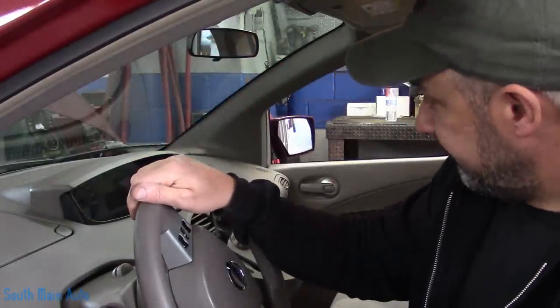So I guess that's it. We're not exempt from making mistakes — myself included, I've done it plenty of times. My suggestion: if you're doing DIY stuff, which I encourage because you can save yourself some money, use that cell phone of yours before you start taking stuff apart and take a ton of pictures. Coil wires can easily be mixed up depending on how they're oriented, and wire harnesses will reach each other since coils always have the same connector. Go down in the comment box and leave your mistakes. Subscribe, ring the bell — if I can do it, you can do it. Thanks for watching.